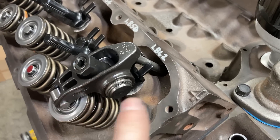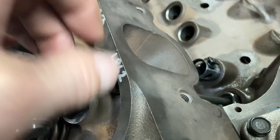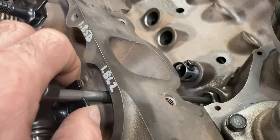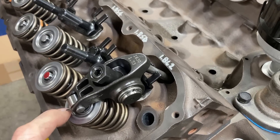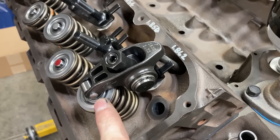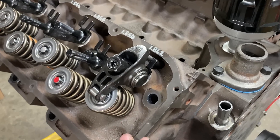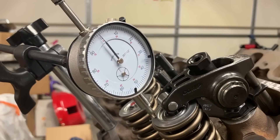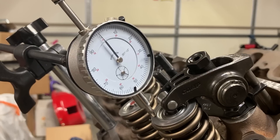That also means we're going to have a ton of room between our pushrod and the rocker arm fulcrum, which is where we were having trouble with the regular Comp Cams rocker arms I was trying last week. I've got a pushrod that looked pretty close from my collection of different lengths, and I'm going to see where I am — checking lift at the valve to see where we are as far as pattern and lift. I should have about 628 thousandths lift at the valve.